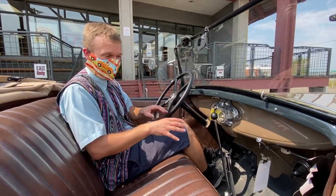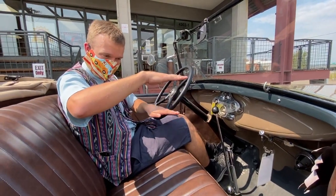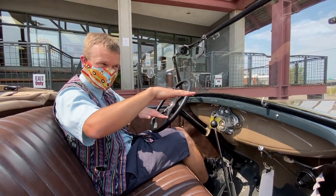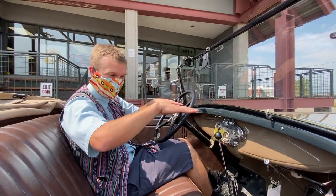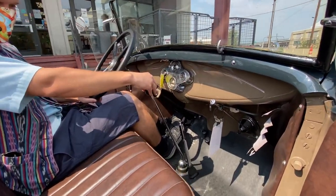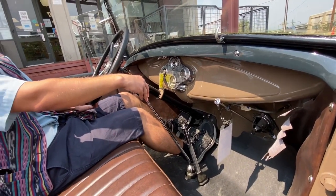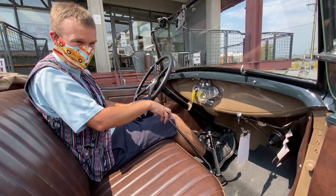Shifting back down is a little harder. You have to raise the RPMs. We're in second with lower engine RPMs; if the wheel speed stays constant, we have to raise the engine RPMs back up to first gear's ratio, because we're going into a lower gear. So what you have to do is clutch in, put it in neutral, give it a little bit of gas to raise the RPMs, then put it into first, and then clutch back out.